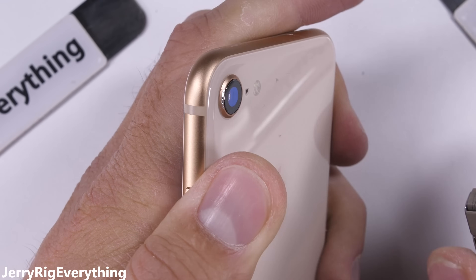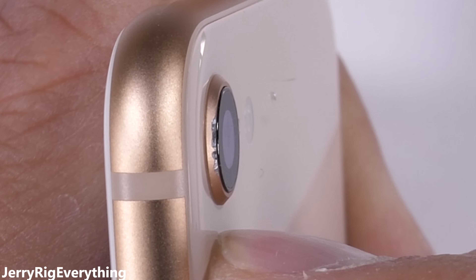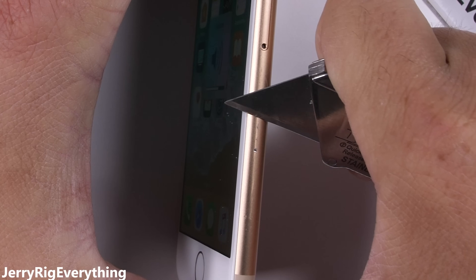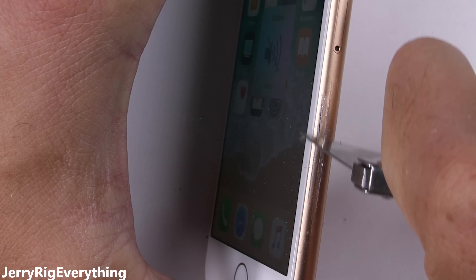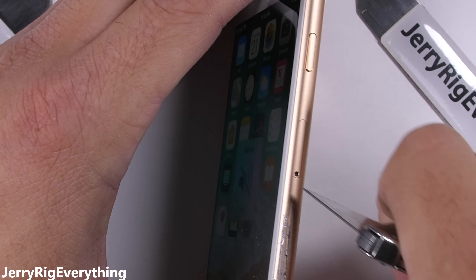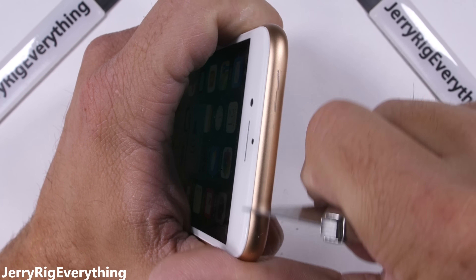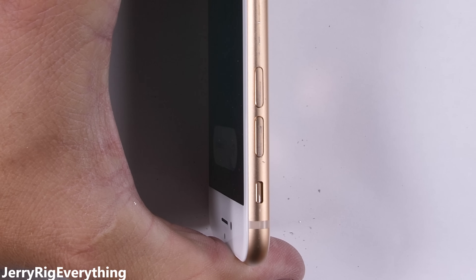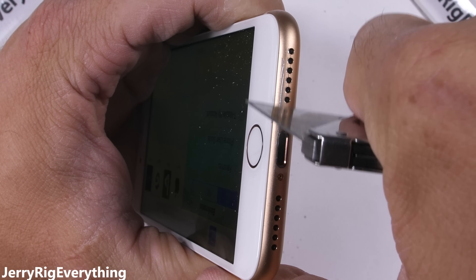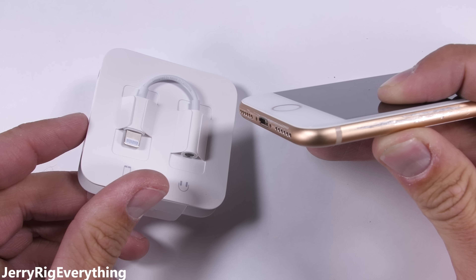There is a metal ring around the camera lens, but the weird part is that the camera lens sticks up even farther than the metal ring does, so there's no protection for that lens — and since it scratches at a level 6 instead of a level 8, it still needs that protection. The sides of the phone are real metal, so Apple did a good job there — this handles keys and coins very well. But my razor blade manages to remove some color, exposing the silver 7000-series aluminum underneath, so it's best not to keep your razor and phone in the same pocket. The SIM card tray, power button, volume buttons, and mute switch are all metal — bonus points for that. I'm still definitely a huge fan of that mute switch; I wish more Android phones had that feature. The singular proprietary lightning port is at the bottom, still metal, and still no headphone jack — though Apple has been kind enough to include a dongle in the box.